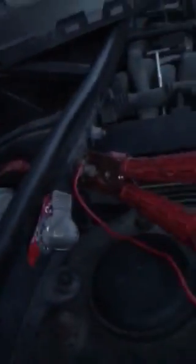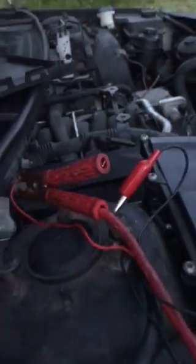Now if your ignition is in position 2, your car should crank right up. So let's go ahead and try that right now. Let's go to open the vehicle. Let's put the key into position number 2. Still getting no start. No start when we turn it. However, everything else is on. We're going to come back over here to our relay with this little device that we made up. And very carefully, there it goes. And there you have it, vehicle fixed.